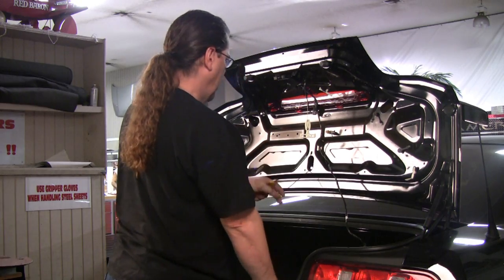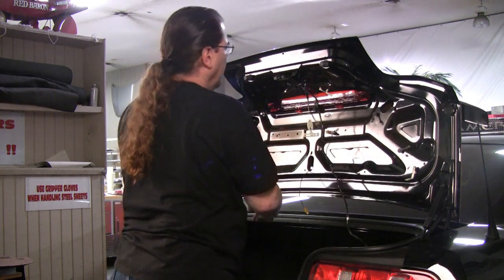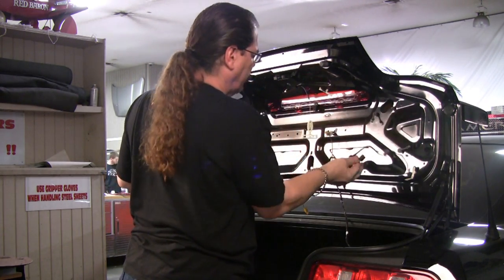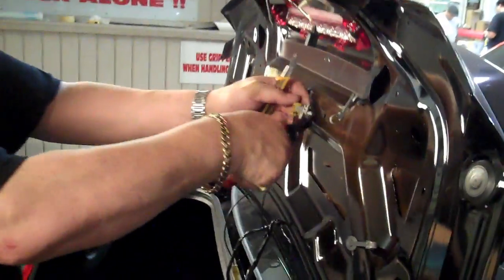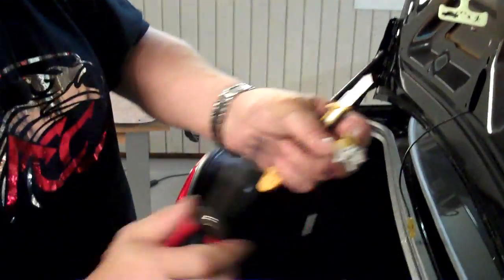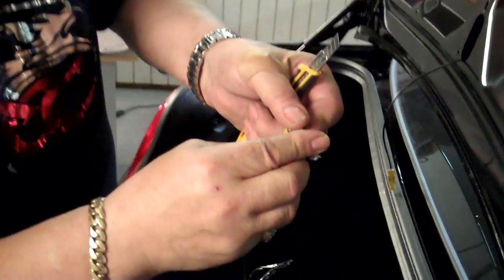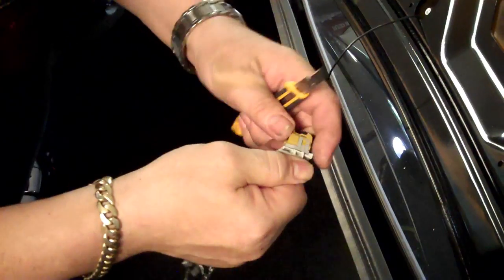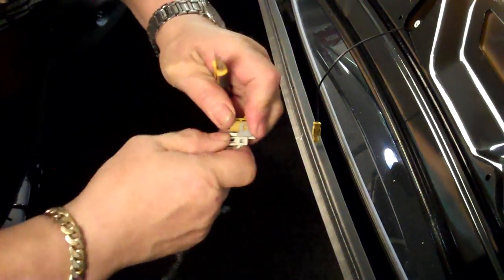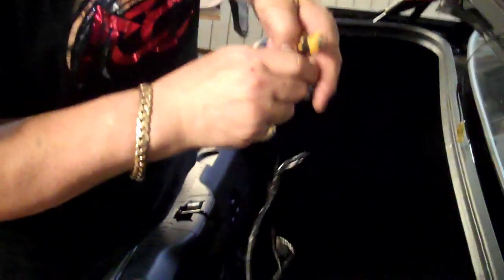This is going to release the satellite antenna. Then you have your rear third brake light, or your fifth brake light. And then you have your trunk release, which you're also going to separate. Now this, you're just going to have to separate from your deck lid. Remove that. This little clip is no longer going to be necessary, so you're just going to separate it like so, and this way it'll be a little easier to put away. I think that's bonded like this. There it goes. Okay, and that separates that.